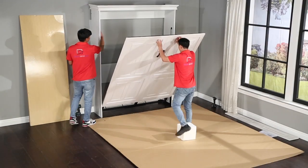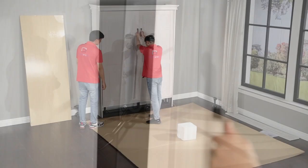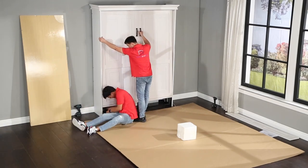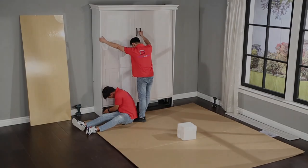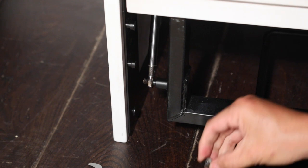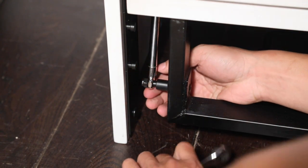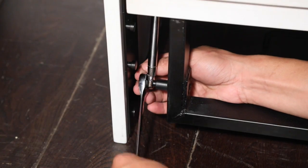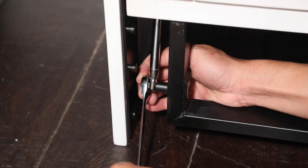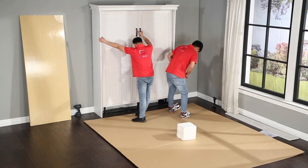Okay, lift the bed tray and connect one of the safety chains. Press and hold the bed tray back inside the bed case. Reach inside the bottom of the bed tray and locate the gas spring rod. Connect the eyelet on the gas spring rod to the gas spring post on the bed frame. Now install a k143 lock nut and tighten it up. Do this on both sides.